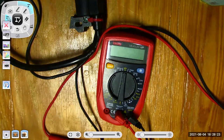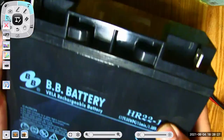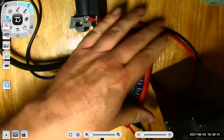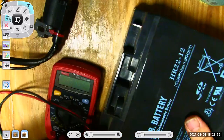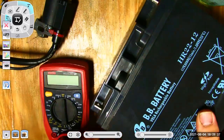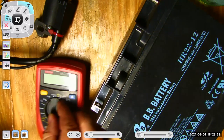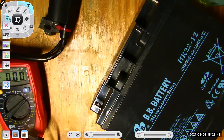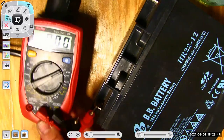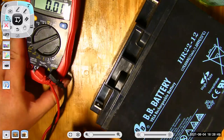I got one other battery. I'm going to bring this guy up again. He's another gel cell. But I'm going to bring him up on the screen here. Now he's been sitting below my bench top for 6 months, so he's probably a little low on charge. Let's see where he's at. I'm going to throw this guy over the volts. I'm going to go to a 20 volt scale because I expected to be more than 2 volts, but less than 20. So that should give me a good reading,